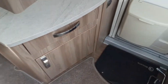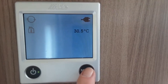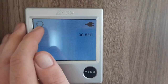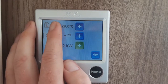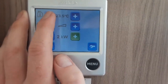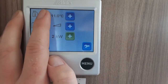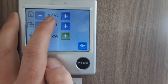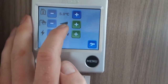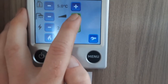Once the system's full you can start thinking about warming the water on board. On the control panel here the heating and hot water pump is running. The top button is for the internal room temperature — minus to turn it down, plus to turn it up. The heating is off when it's set to five degrees. Below that you've got your hot water: hot water is on when the bar is half full, and hot water boost is when the bar is completely full. So: off when empty, on when halfway up, and boost when the bar is full.